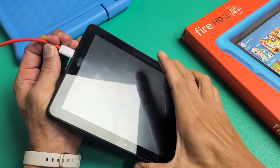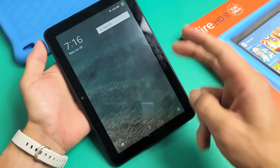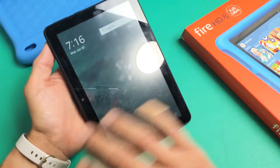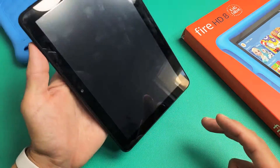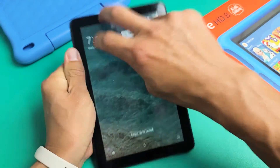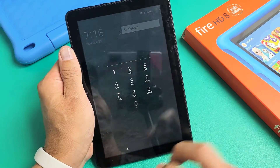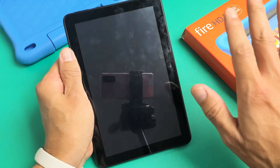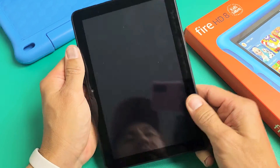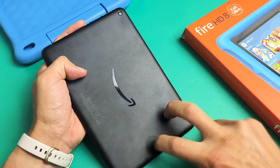Okay, so option number three. Let's go ahead and unplug it. Now what we're going to do here is what I call the tapping method. We're going to tap all over the screen as well as the back. The whole premise behind this is you may have something that's slightly dislodged, and a simple tapping can pop it into place, turn the screen on, and you'll never have an issue again. Hold your tablet in your hand and use two fingers to tap everywhere on the screen — kind of hard, all over. Sometimes as you're doing this, half the screen might pop on, you might see white lines, a white flash, or sometimes the screen will just turn on and you're good to go.